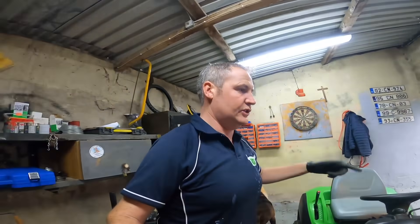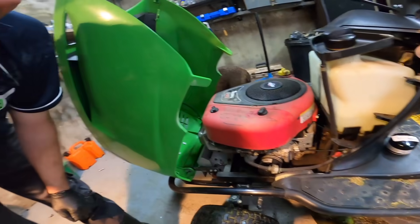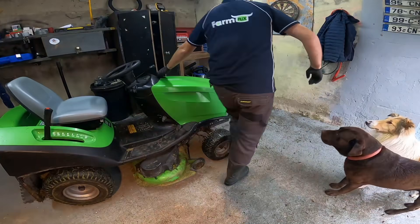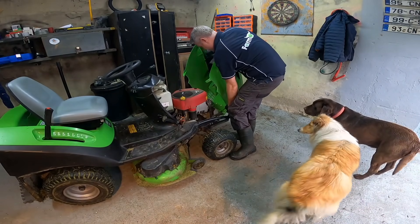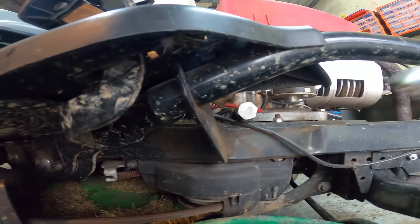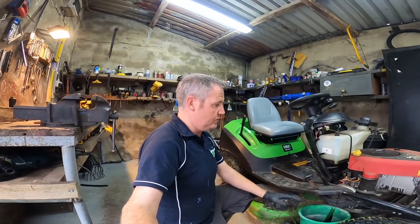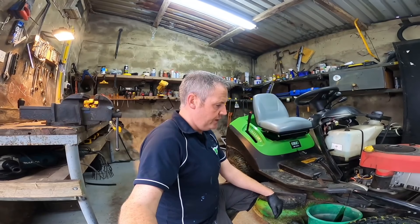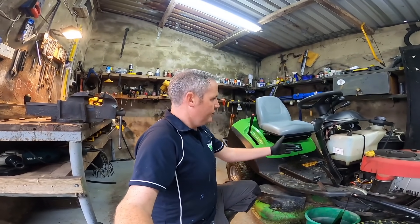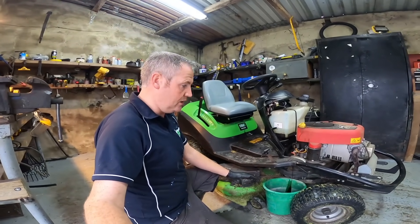The oil is the next thing, so I'm going to have to turn the mower around because there's a slope in the shed. Then we're going to cut off this filter here and slam a new filter in and fill it with the oil. One thing I would say when you're changing the oil in these mowers is to run it for a while — get it nice and warm, not boiling hot but just warm, a few minutes is sufficient. That way the oil will come out a lot easier and quicker. I've also jacked this mower up at the back ever so slightly to get as much of that oil out as possible.